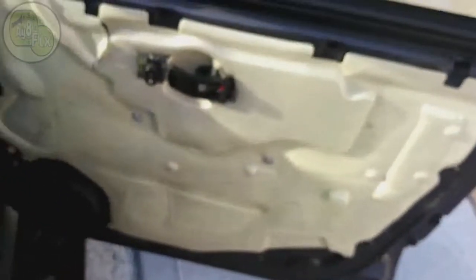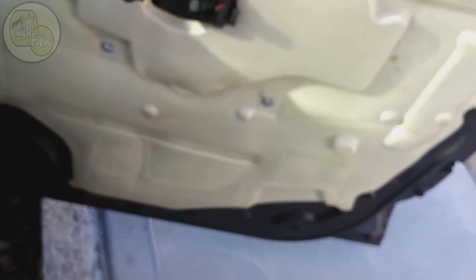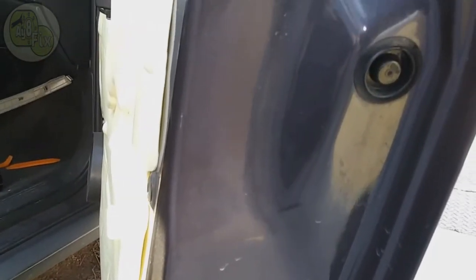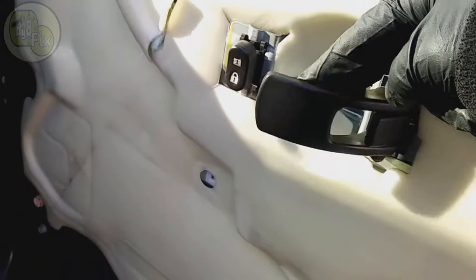Now I've gotten that off. You have this padding on the back of the door — this is soundproofing and it's glued around the edges. You pretty much just take that padding off; get something sharp and cut the glue. To get behind the door for the inside door latch replacement, you're going to cut around the edges of this foam so you can get behind there. As you can see, the latch when I pull on it is loose but there's no motion of the door opening.